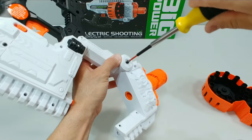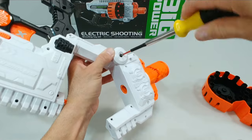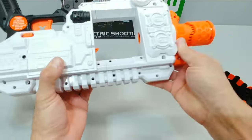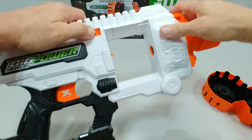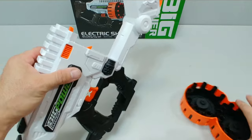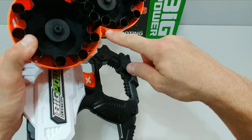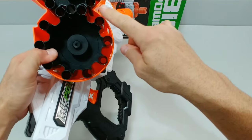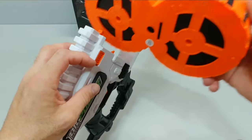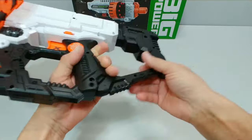Then you insert your center screw and drive it home with a bit — make sure you have a handle on this one, because the screw is creating brand new threads into that plastic receiver on the other end. Make sure it locks nicely. Then you can use this switch here to depress the front assembly forward in order to install your drum set. The drum set only goes on in one direction — these tabs indicate the bottom of the drum and go into the accommodating inserts. Just sit the drum back evenly and lock it into place.